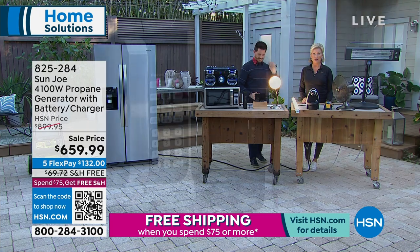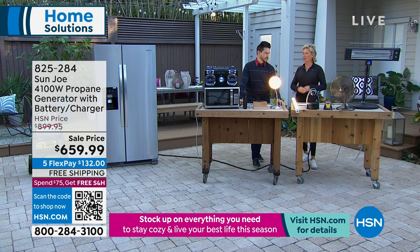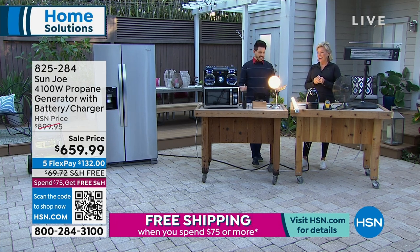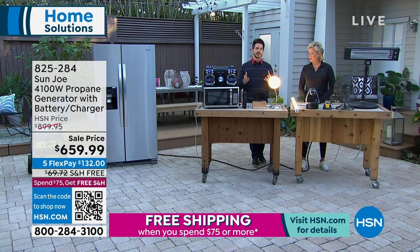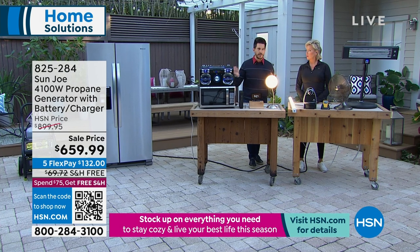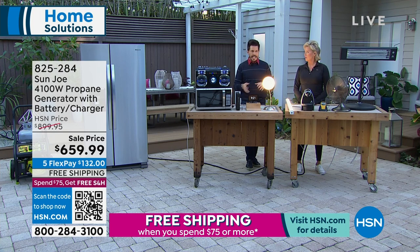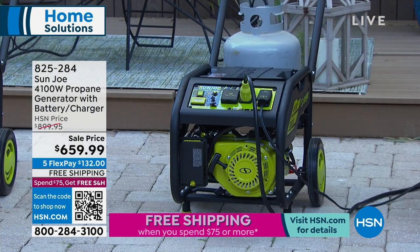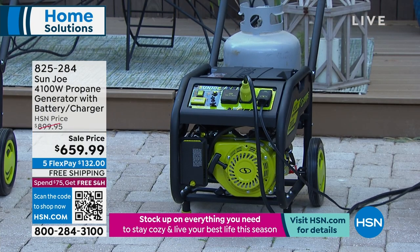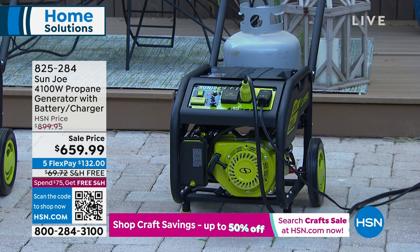There's also a fuse — if you overload it, the fuse pops out for safety. Once you get this home: easy assembly — put the feet on, put the wheels on, add your 10W-30 oil, bring a 20-pound propane tank — which is readily available and the same one you use on your barbecue grill. Running at about 50% power, you'll get over nine hours of usage. You could get a whole night's sleep with the generator still running your house, and hopefully in the morning power is back.